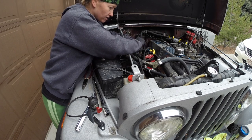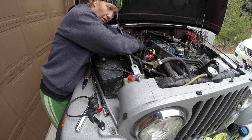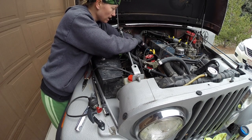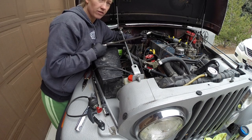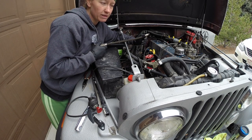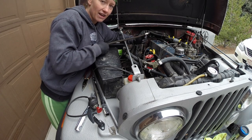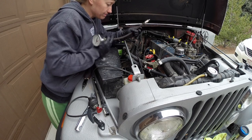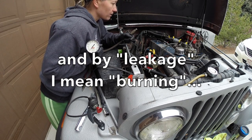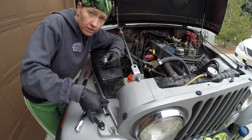They're all within 10% of each other, so maybe I don't need to take the head off and redo the piston rings after all. I do not know why it's burning oil, but if they're all within 10%, I shouldn't have to do a cylinder leak down test. That's nice because that's a little bit time intensive — we'll have to make that video for another day. To be continued on the oil leakage problem. Now that that's done, we'll just reinstall our spark plugs.